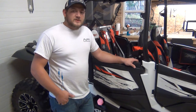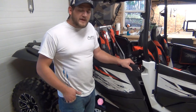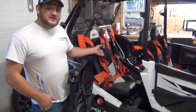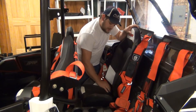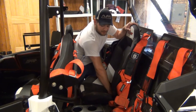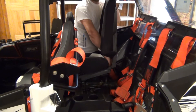To begin the installation of the rear seat rack, the first thing you must do is remove the seats from the back of your Razor. As you can see here, we've already removed one seat. If you've never removed your seat from your Razor before, the way you do it is you reach back here. There's a small lever under the seat. You pull that lever up, tilt the seat forward, and then lift it up out.